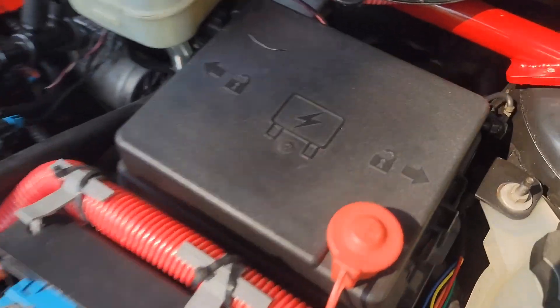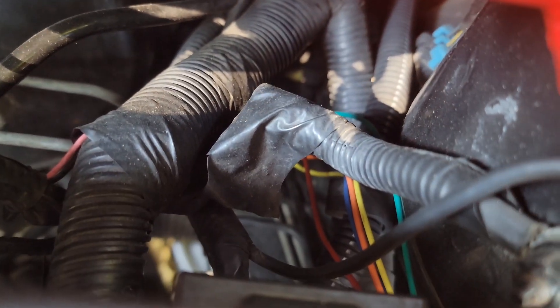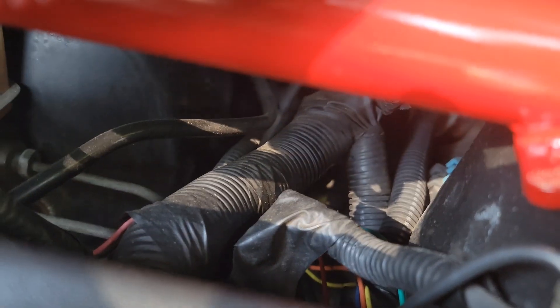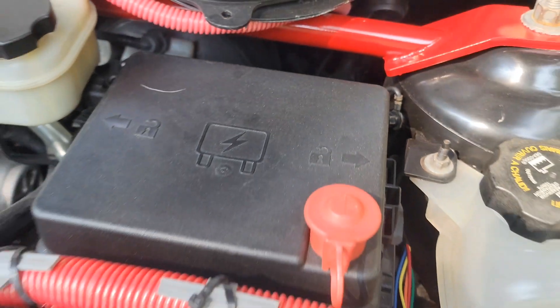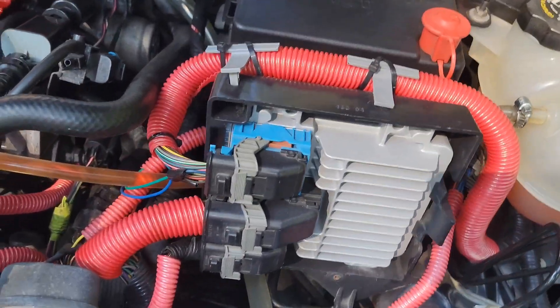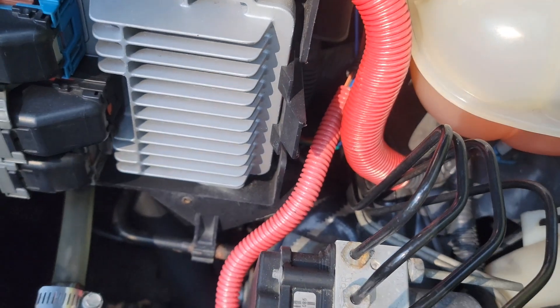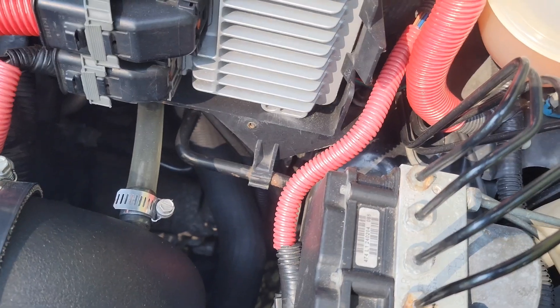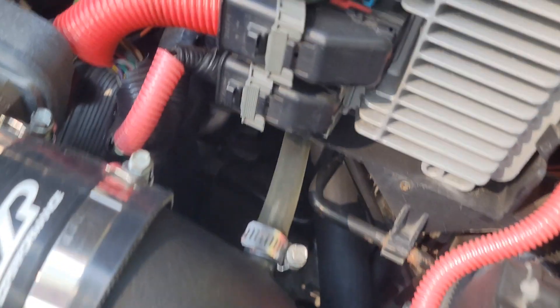Back under the hood, you can see those five wires coming out through the firewall. There's a nice little grommet and it's just behind your fuse box. With those wires, you don't want them touching anything hot. I ran mine around this side of the fuse box, kind of down the edge, and where I started getting up to where things may start getting warm, I put some tubing on the outside of it.